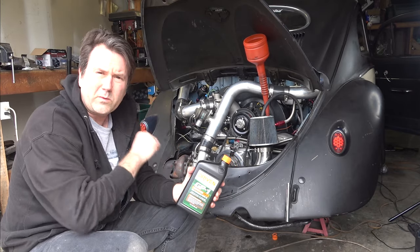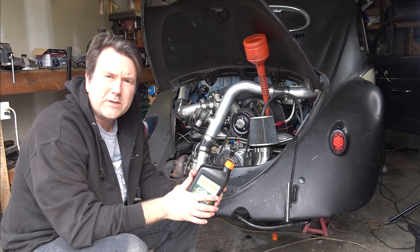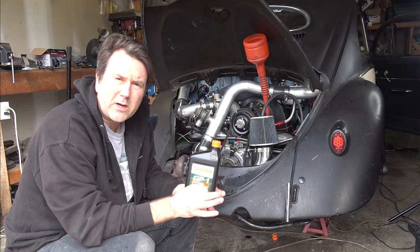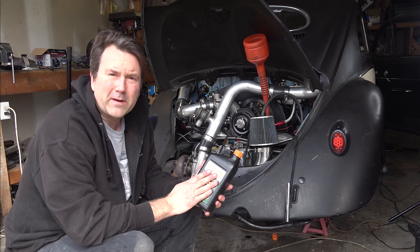It's that oil tee that I put on. I might not have got the pressure gauge all the way tightened. That may take a little Loctite or something to seal that up, or maybe a couple more turns. We'll hope that's it.